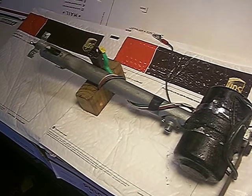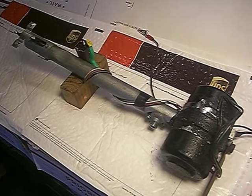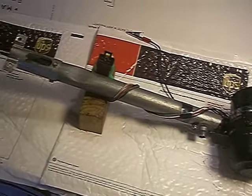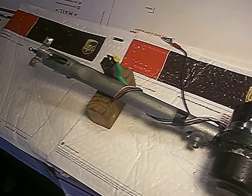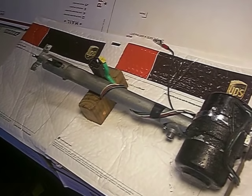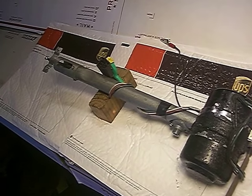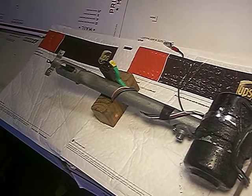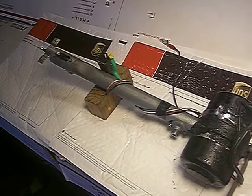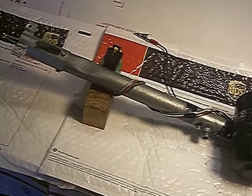This unit was damaged, had a bad limiter switch with a rotator wheel. One of the gears was chipped, one of the gears was snapped in half in the timing mechanism. And of course the actuating rod for the 3-segment telescoping mast was broken. So the unit's been totally taken apart. The movement has been completely reconditioned with the gears changed, everything refitted, oriented, timed, lubricated, reassembled, and the actuating rod for the 3-segment mast replaced and recalibrated and aligned.